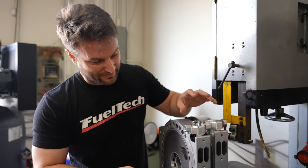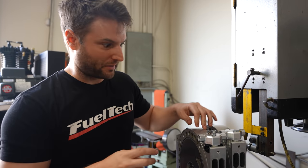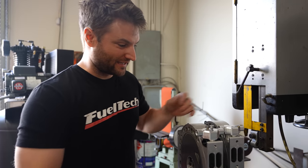This is the wave of the future for me. You can't see this, so you can't visually inspect it. This bolt is purposely countersunk so that the intake manifold coming up just barely grazes it. Even though it's bulkier, it is the lowest-profile setup I can do. I'm very, very happy, very thankful for everybody involved. We're ready to reassemble the four-rotor. This is what I've been holding off on — being able to recreate these and make them even better. There's a couple more mods we'll be doing, but not to these; we'll be doing them to my own billet irons. That is the four-rotor. That's what nine months of waiting has been — I finally have the confidence to do this. It's 100% ready to go and honestly safe.